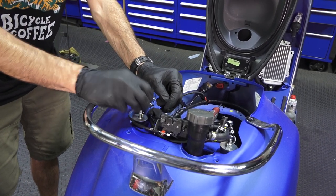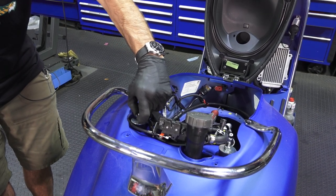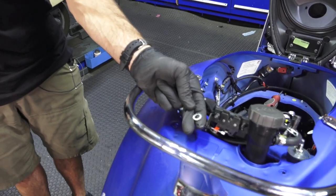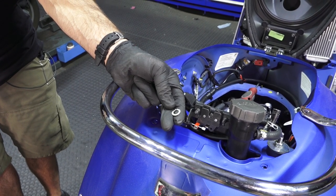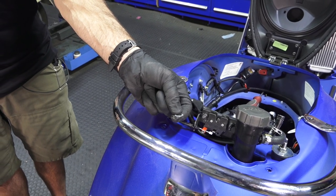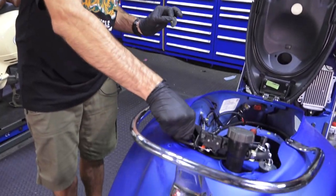If you're putting a new set of stock shocks back in, I'd highly recommend replacing the locking washer. Part number 012534 is the replacement locking washer. Alternatively, you can use a NordLock M8 as a higher quality lock washer. You have a flat washer that pulls off, and next a smaller rubber donut that pulls off the top of the shock shaft.